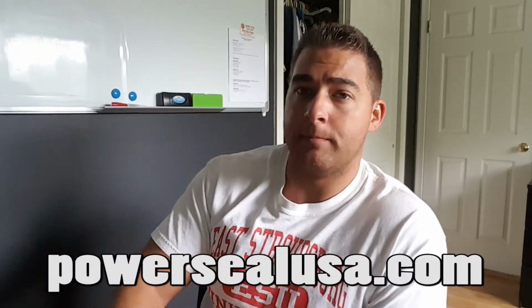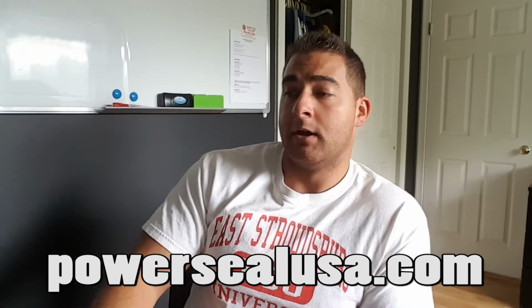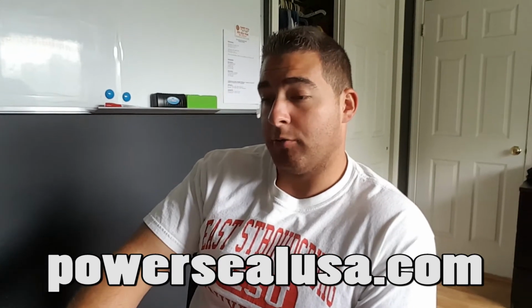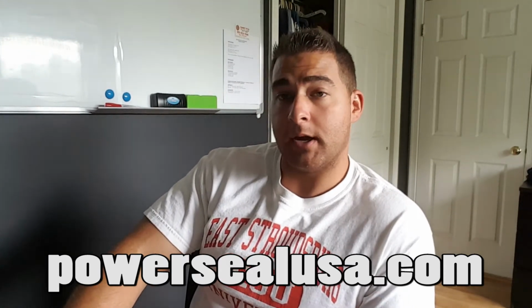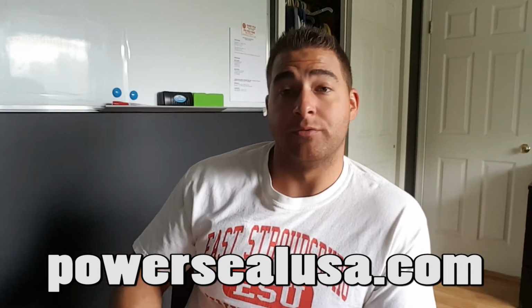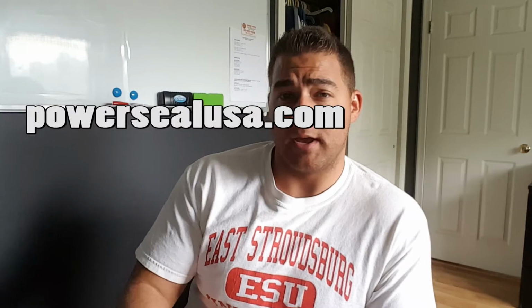So that's pretty much for any cylinder that they have. If you go to their website, PowerSealUSA.com, they have all their services and what it costs laid out really nicely and straightforward. This was a KX100 cylinder that I sent to them. It wouldn't have mattered what kind of cylinder I sent to them. It depends what's wrong with it. Now, this one needed repairs and it needed a rebore, so there was some extra stuff. That's why it would have been around $300, because I had that cracked intake and everything. But if you just needed a rebore or a finish up, or if you have gouges, I think it probably wouldn't be that much.